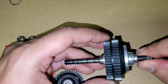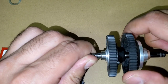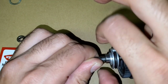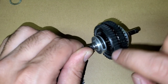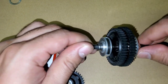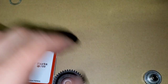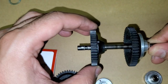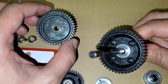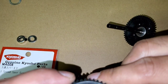So as you can see — pretty simple design here. That's your first gear, which is pretty much always engaged, always turning the shaft. These other gears will only engage once their respective clutch engages. This one will only engage once that centrifugal hook grabs that nub inside the gear. The second gear cam was fine — let me just show you: this is the second gear.